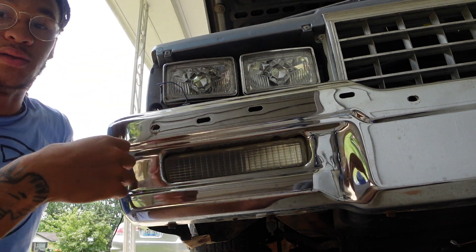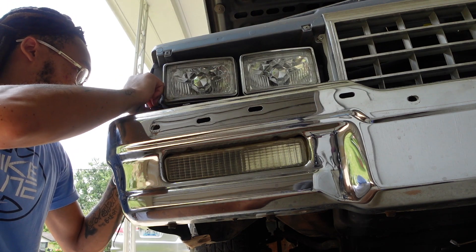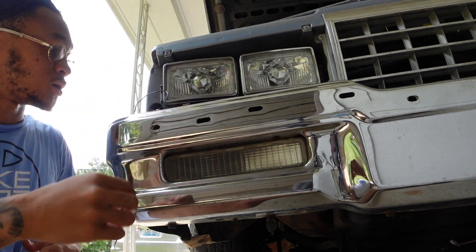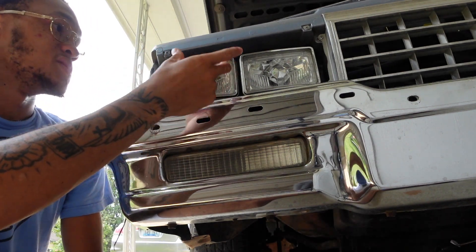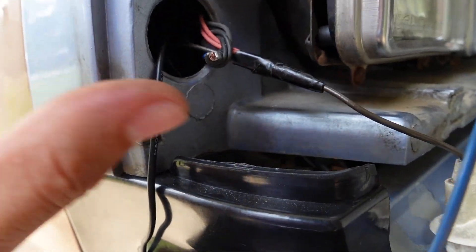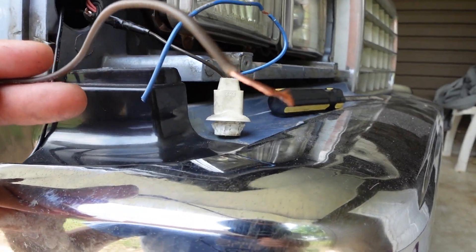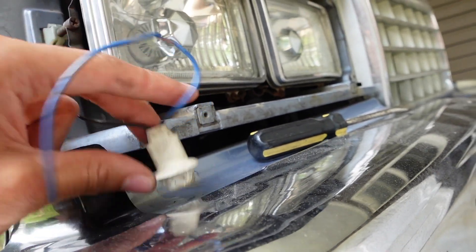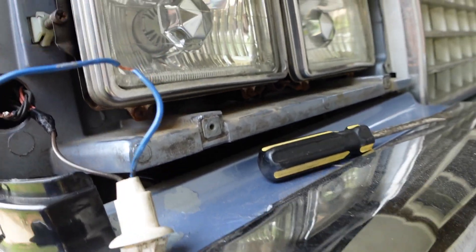There we go. Let me tape this up and then we're gonna move on to the power part. Hopefully everything should be good to go because I think it was just this plug that was bad. If it was a fuse then none of my headlights would work; if it was just this side then my taillights wouldn't work, but my taillights are working. So I need to tape up this ground, then undo the power part, then put the new power part on. I already stripped it out a little bit so I can have some more wire exposed. Let me get this finished and come back to y'all.